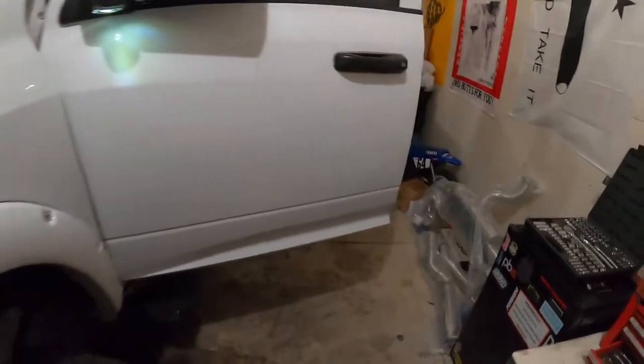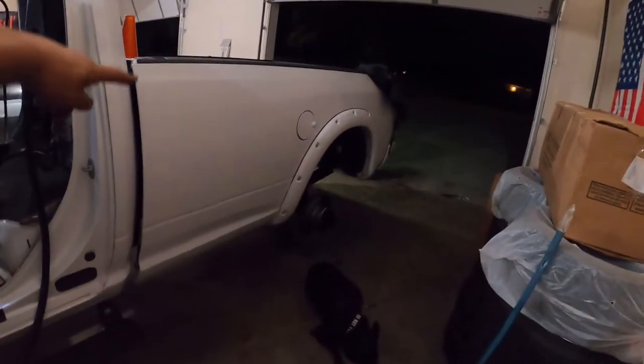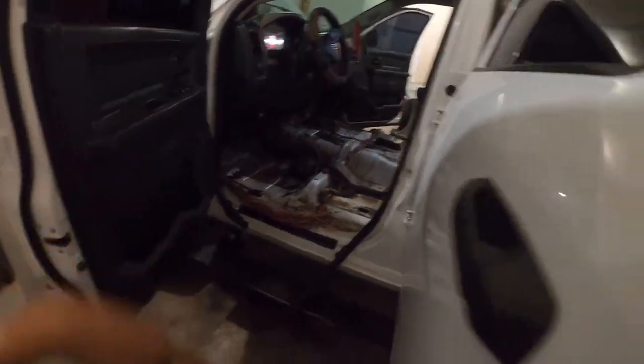I did the brakes, I bled them. You know how it goes. You start from the farthest away, then passenger, driver, passenger, driver, however many times you want. It's a process, it takes a while. Brakes are finicky, so you want them mint. Take your time. Do a good job.